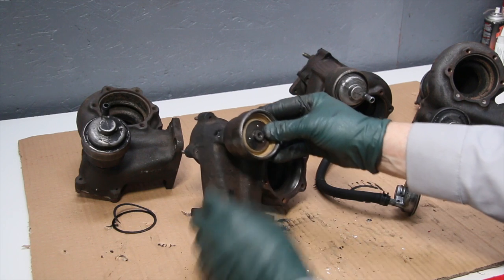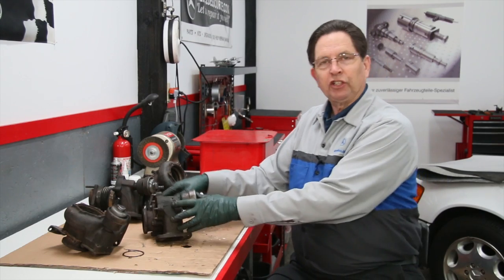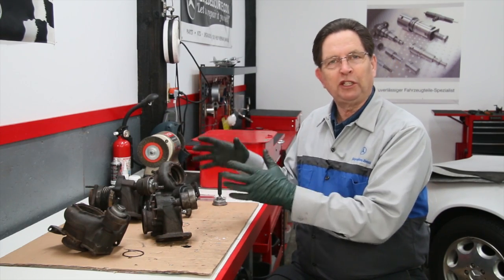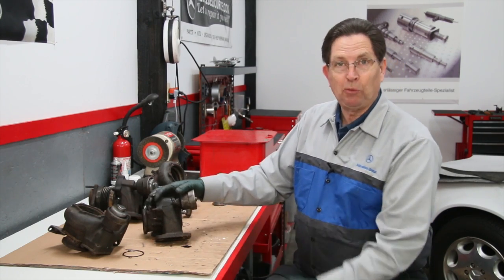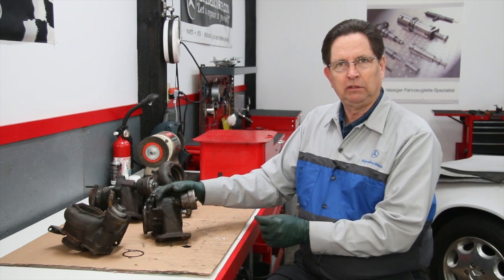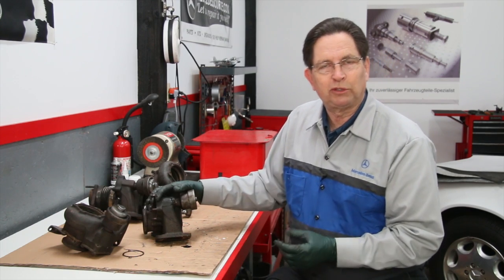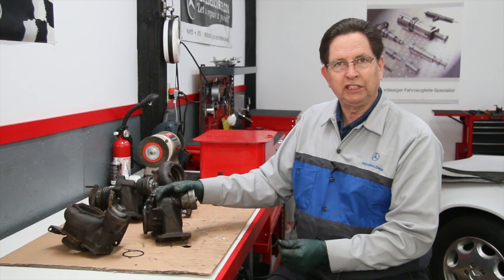That gives you a simple overview of what the wastegate looks like and what its function is. Mercedes Source probably offers the best T3 turbo overhaul kits on the market for you to overhaul your turbo on your own older Mercedes diesel. You may not know that we can also help you with wastegate issues. Adjusting the wastegate is really important, particularly after a turbo overhaul — you may increase the boost pressure because somebody may have adjusted it while the turbo was worn out, and now you've got a turbo creating too much boost.